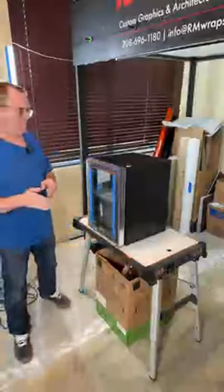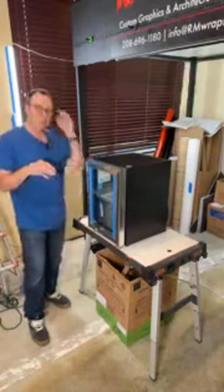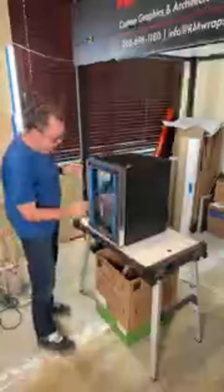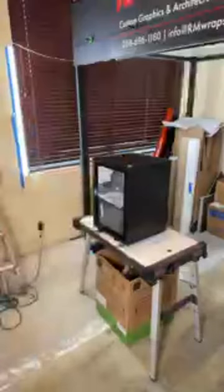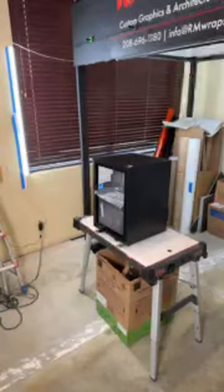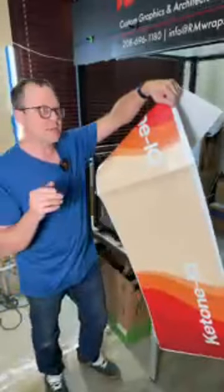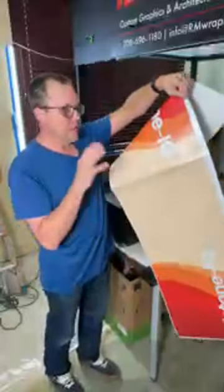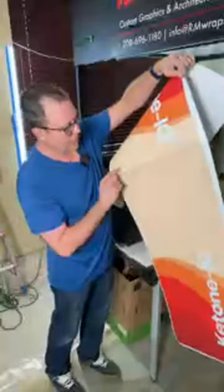If you just want the vinyl itself, you can buy it and wrap it yourself — I'll show customers this video so they know how to set it up. I masked a few parts and removed the door. I like to do the body first, and everything is already pre-cut and pre-printed. This is the body printed on 3M air release final matte sheen — we do about 90% matte sheen and some gloss every once in a while. Whether we're installing it or you are, we put a crease mark and little dots indicating the corners, and we pre-cut the backing for you so it's easier to install.